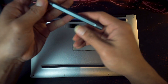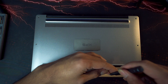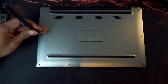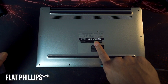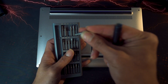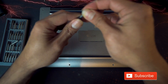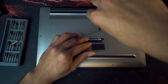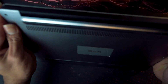Let's put back the screws — 1, 2, 3, 4, 5, 6 — it's missing. 7, 8, and another one would be here. This one is a flat screw and not a T5, so we're gonna replace it. For this one I think we're gonna use the Phillips head 00. Let's check if that will fit — yep, that will fit. We're gonna replace that. That would be all. Let's try to open it.